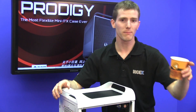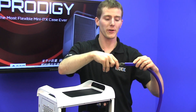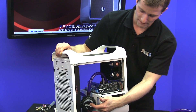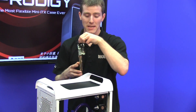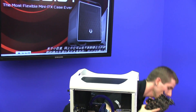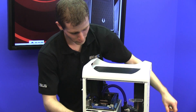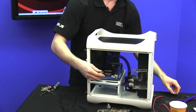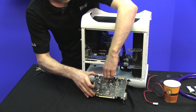One tricky thing I should mention is my old trick with the boiling water and needle nose pliers. You dip the tubing into the water and then stretch it with the pliers in order to get 3/8 tubing — which is what we're using — over half-inch fittings, like on the MCP655 and the stock fittings on the Apogee HD, which I wanted to use because they're black and look great. Speaking of compression fittings, I usually recommend installing them without the covers on — just screw them in like that. I like to give them one last crank with a rag wrapped around the fitting and a pair of pliers, going in nice and tight — pretty much as tight as you can.